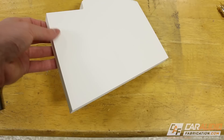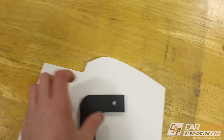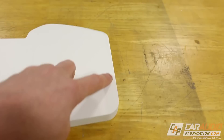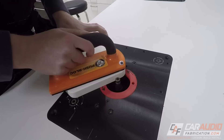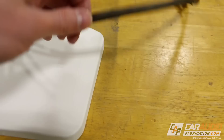I've got all the hard edges cleaned up and looking good — I've even added a nice arc curve here. Now I want to soften up these corners to make the piece look a little more finished. I'm also going to flush trim a radius into each of these corners. All the big pointy corners are now rounded over and softened. The last thing is to soften the top corner completely around the outside using this little 1/16th inch roundover bit. I like to do this because it gives the edge a much more finished look, and it won't damage any wiring rubbing against it as it vibrates over time.